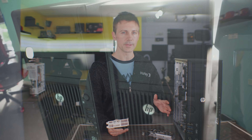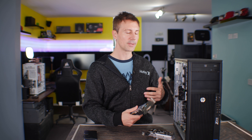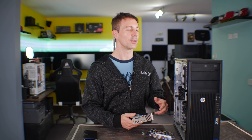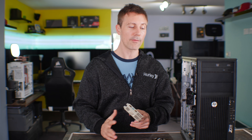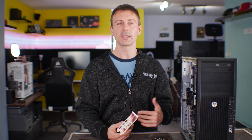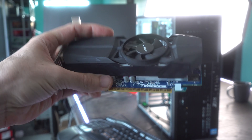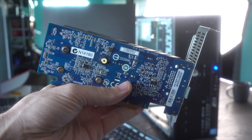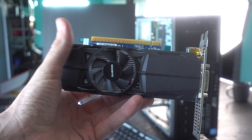There were no intermediate faults — it was just gone. What ended up happening was that computer had a faulty power supply. I didn't have time to inspect it so I replaced the whole PC for the person. That person then got a replacement PC with everything changed. They came back another week later saying this PC is giving a black screen, and the graphics card — the one I'm holding right now — ended up being toast. There was no bringing it back. I thought perhaps the graphics card was on its way out, so I replaced it with a GTX 750 just to check.